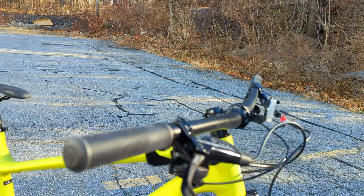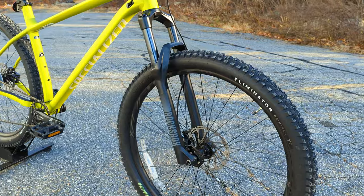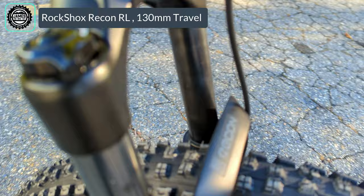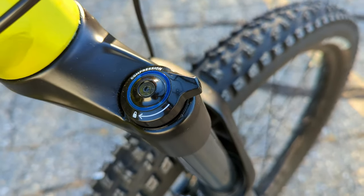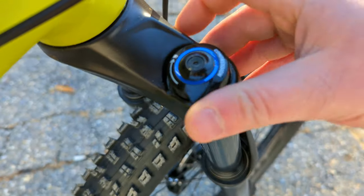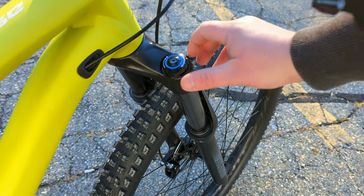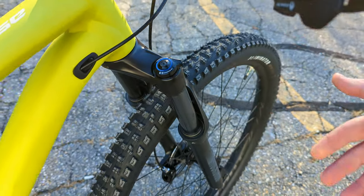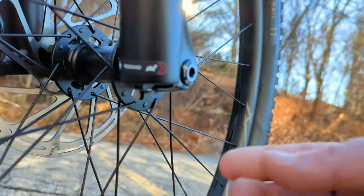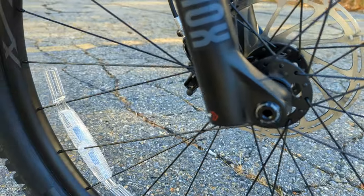Moving to the front of the bike, we've got that 130 millimeter suspension fork. The fork on the comp version is the RockShox Recon RL. The RL has a damping unit adjustable from open all the way to lockout, with individual click stops to essentially lock out the fork from having any travel. All the way open it's nice and fluid. Going down you have rebound adjust just under the fork with a dial adjustment, right next to the 15 by 110 thru axle.